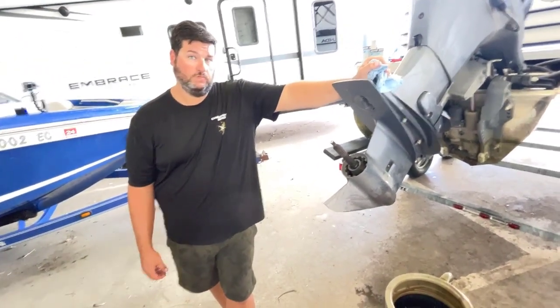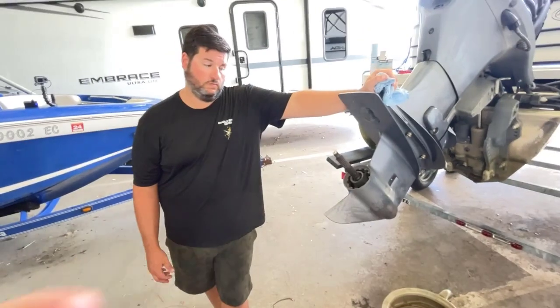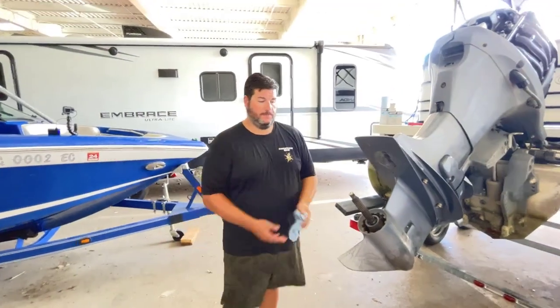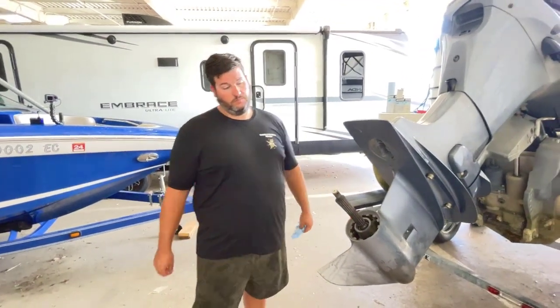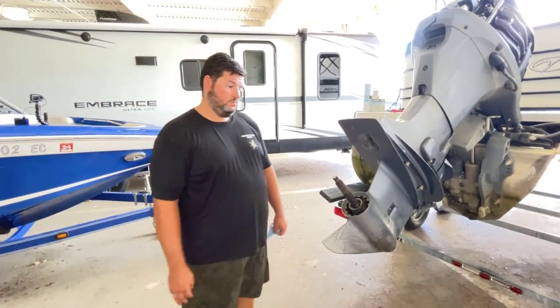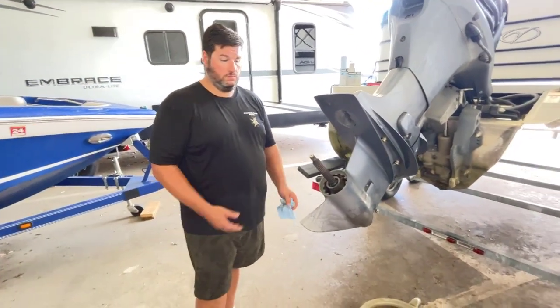I mean, how many boats a year do you see that have at least some fishing line wrapped up in there? I would probably say 25% of boats. Yeah, so it's common enough that it's something to be aware of. And if your lake is a big fishing lake, I would say even more so worth pulling that prop every now and again. You see how easy it is.